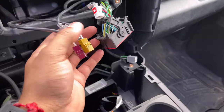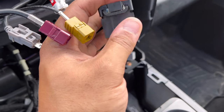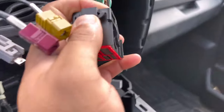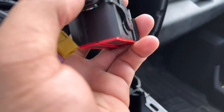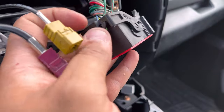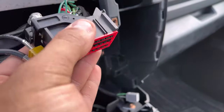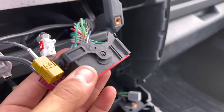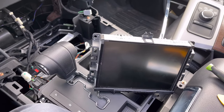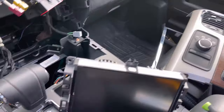All clips are removed. For anyone who needs help with this particular connector: all you do is pry up on this a little bit, push in, and it will come right out — you push up and this lever actually spins up and then it easily slides itself out. Pretty easy to do. Sometimes it can be a pain if you've never come across these before. Now that we've got it all out, let's look at what steps we need to do to integrate all our systems into the new radio.